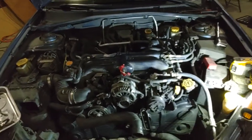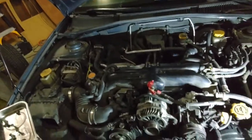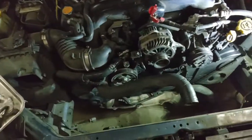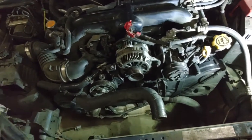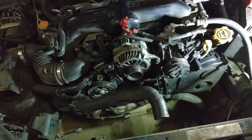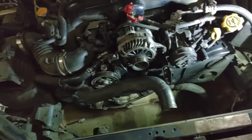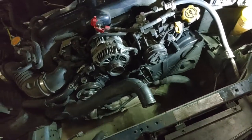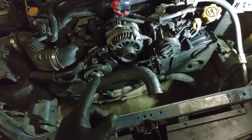Welcome back. As I said in multiple videos, I'm breaking these up into segments to get you to what you need. If you're looking at replacing your alternator because it's not charging, or you suspect it's not charging, this is how you get it out. Take it to an auto parts store and have it bench tested — though bench testing doesn't always give you the final answer.